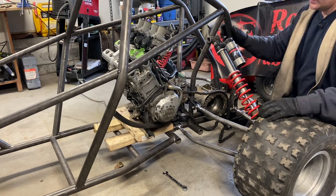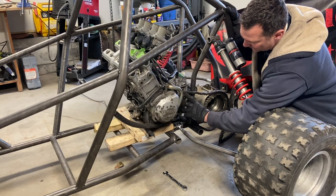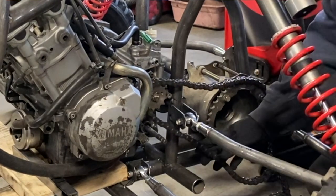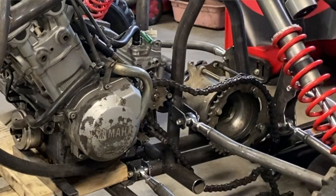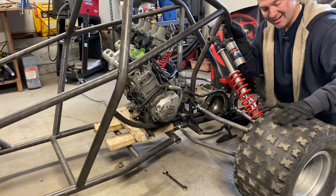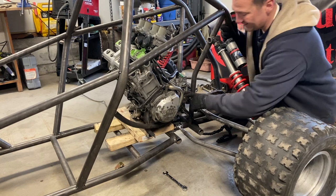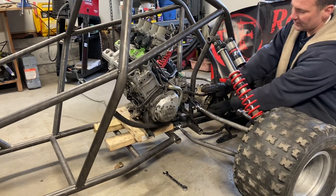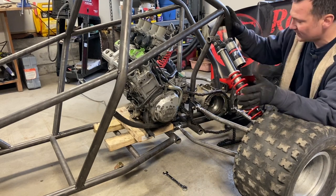We've run into a little issue: since we need to run the exhaust under it, that raises the whole motor up. I designed this so the chain rides around the forward upper control arm. I've got a 14-tooth sprocket on the front and a 38-tooth on the back. Since this is a motorcycle engine and these aren't 20-inch tires, the gearing is reduced dramatically — the front sprocket is going to be 17-tooth, the rear 43 or maybe 41. That's going to expand things out, so we shouldn't have to worry about clearance.